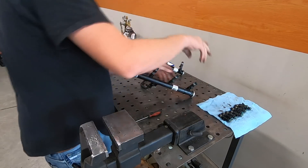In the main chart, knock retard is in red on the third row across, and as you can see, this spiky line is going all over the place. Right here it's pulling four and a half degrees, here it's pulling seven, almost eight degrees. It's just pulling timing like crazy because the knock sensors are saying this thing is knocking — let's pull some timing back to keep this safe.